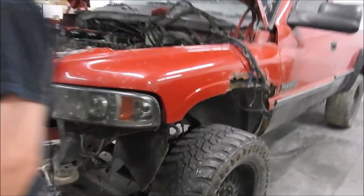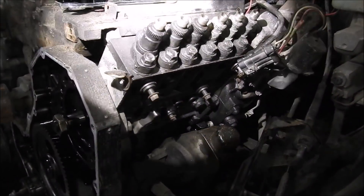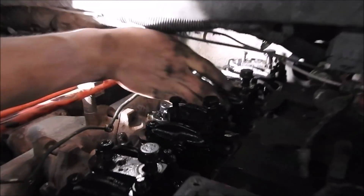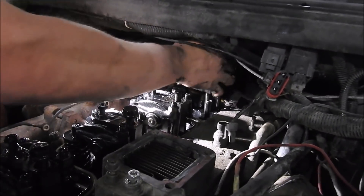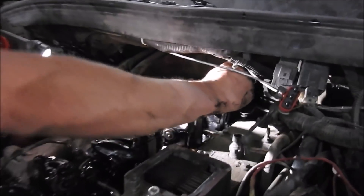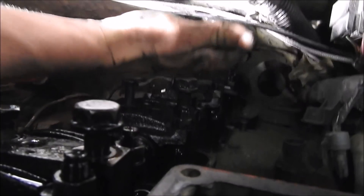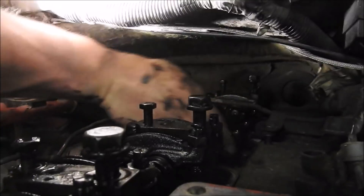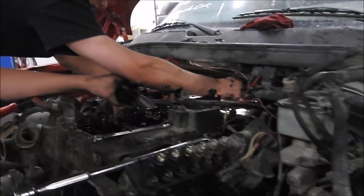Here's the old parts truck — the yee yee truck. Whoever had this thing did some serious yee yees. But here's what we want. You see how these rockers are back here — you've got to pull those rockers out. There's a hole you can pull up inside the cowl — it has these little rubber plugs. You just pop those out and then you can pull the pushrods. They just feed right up into the cowl and you can pull them out. Real nice. GM doesn't do that for you.